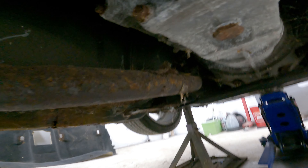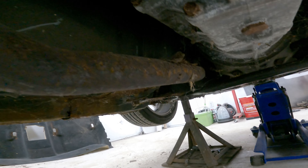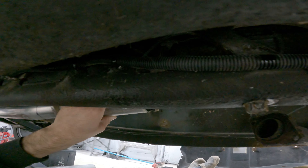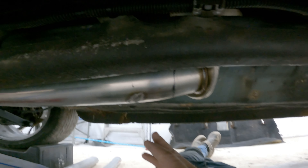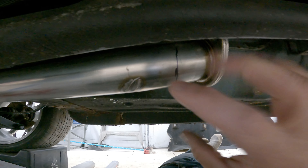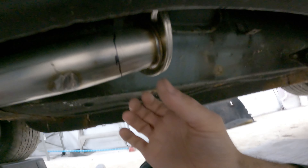So now we're up here. This is what is left of the exhaust on the car — obviously it's in terrible shape, but it's not completely rotted. We're going to replace that flange and cut it back a little bit. The main issue is this comes off at a super weird angle — up and over. When you go to put a pipe to it and sit it flush on the flange, it's way up over here. Something with the NA must be completely different. So I basically just marked it at a point where I think the angle should stop, and I'll basically slice this off flat here. Then we can just continue a straight pipe to connect these two sections.